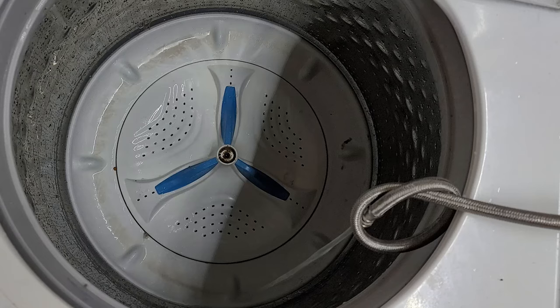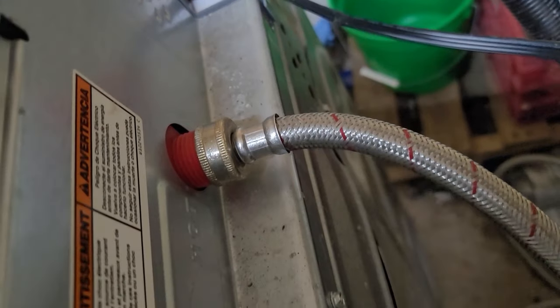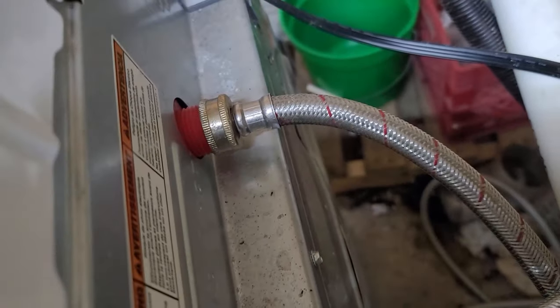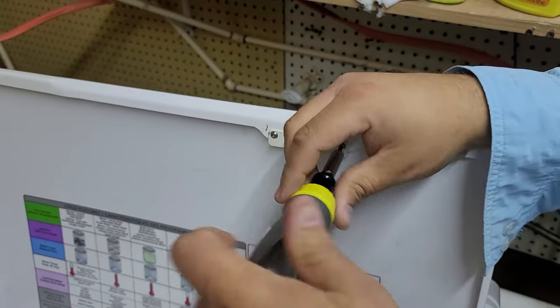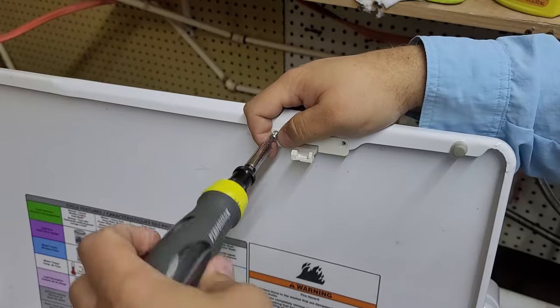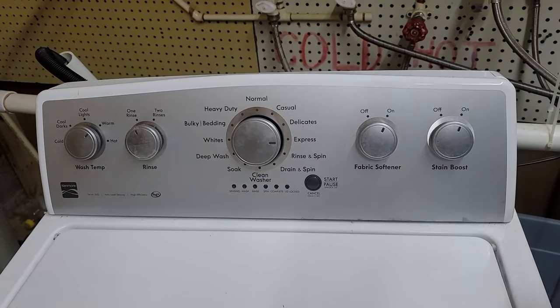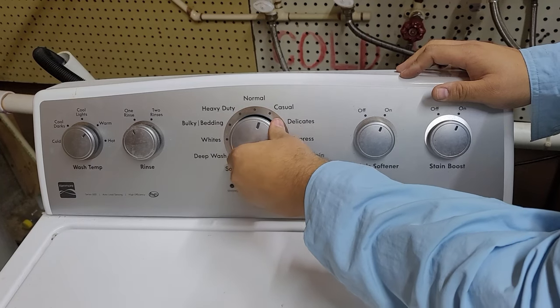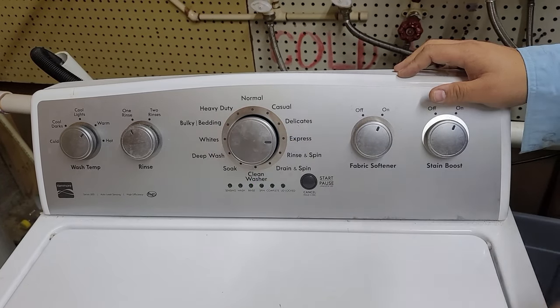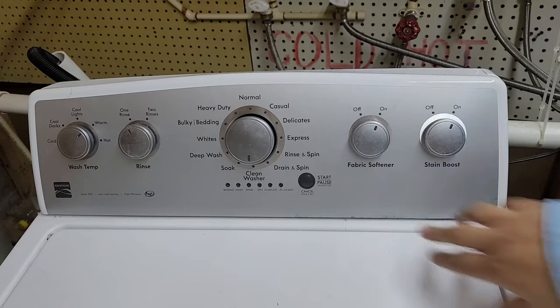You can use the machine's test mode to run agitation or spin without allowing the citric acid-filled water to be pumped out quickly. If you run just a regular cycle, make sure it's on the hottest water setting, or run a cold wash cycle while switching the cold and hot lines so only hot water gets in. You may want to lift the lid while operating these tests, so I'm going to bypass the lid lock by unscrewing the striker with a Torx screwdriver, then insert the striker into the lid lock to allow me to lift the lid when needed. For a full explanation on how to get into this system, check out my Maytag video linked in the description.